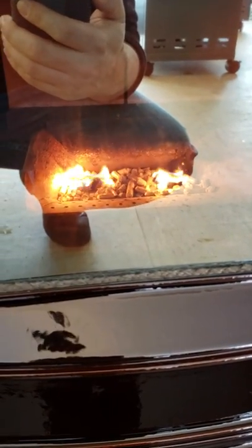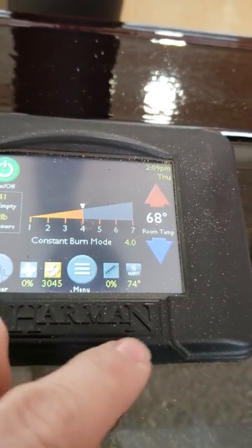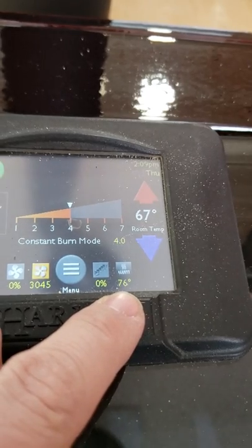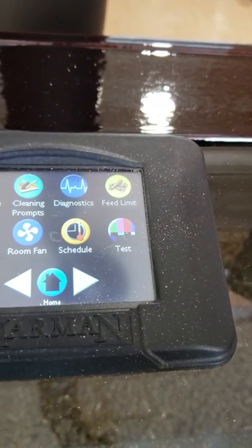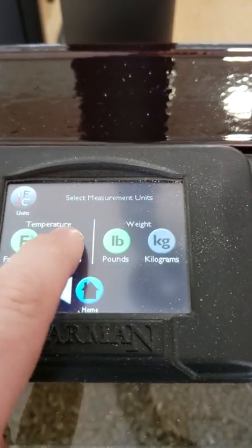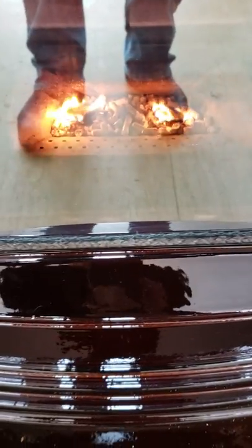A little thing to think about with these new igniters — you're seeing 74 degrees Fahrenheit because we have the stove set in Fahrenheit. That temperature is the ESP temperature — the temperature actually going outside in your pipe. That temperature has to hit 60 degrees Celsius in order for the actual auger motor to start turning. I'm going to go back into settings and change it to Celsius so you can see what I'm talking about. Right now we're at 26 degrees Celsius. When that hits 60 degrees Celsius, the auger motor will turn. As you can see, there are no pellets actually coming into the stove right now — the auger's not turning at all. It has to have heat there in order for the auger to turn.